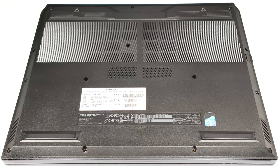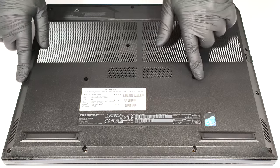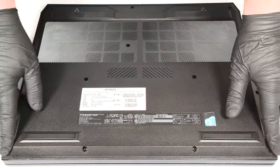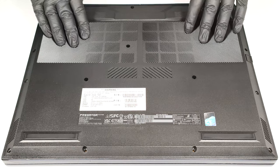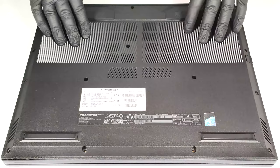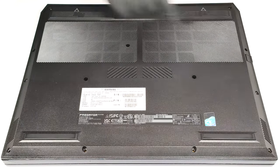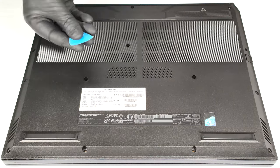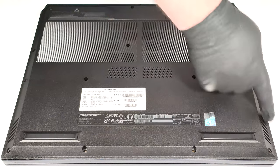If you want to open this huge, powerful device, you have to unscrew 14 Torx-head screws. Then lift the backside by carefully raising it while holding tightly the two plastic exhausts. Don't apply too much force because you can break the plate close to the Ethernet connector. Just use a thin plastic tool to pop the left, the bottom, and the areas around the LAN port.